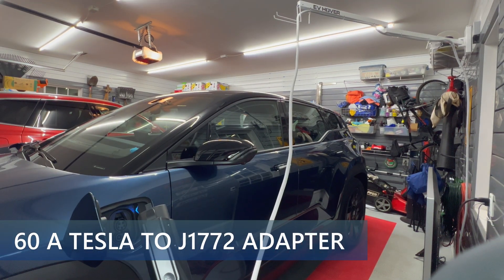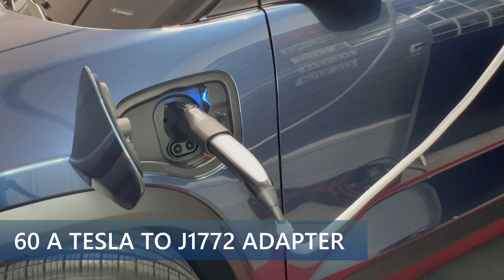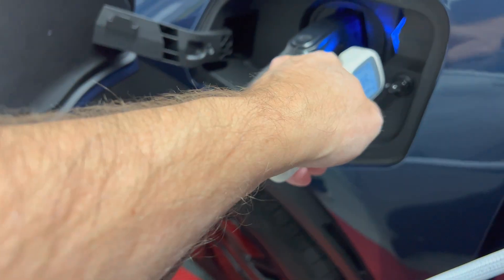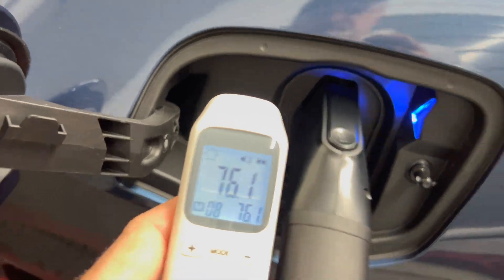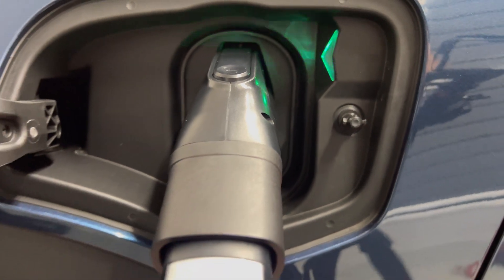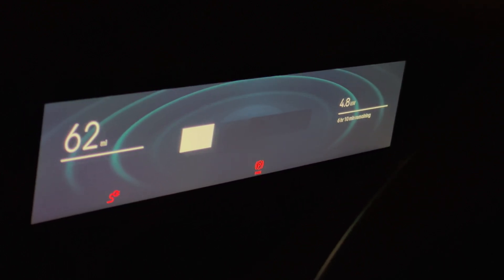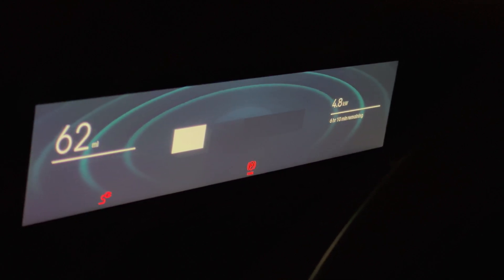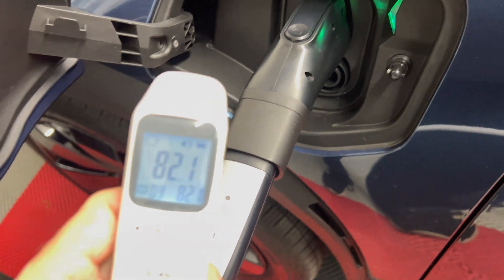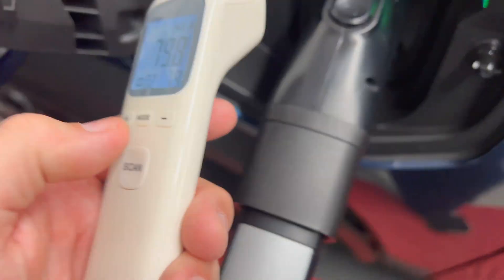Now I'll connect the full-size adapter to test. I will record the temperature on the handle and the adapter at the beginning and then after 20 minutes of charging for steady state. I'm getting about 76 degrees Fahrenheit for all connections when I start charging. This is what it should look like when charging — you'll see the green LED. Going inside the car, the charging rate is around 4.8 to 4.9 kilowatts, which at 240 volts is around 20 amps. Checking the temperatures on the Tesla handle and adapter, I'm seeing anywhere from 4 to 7 degrees above ambient.